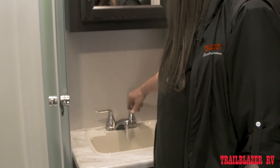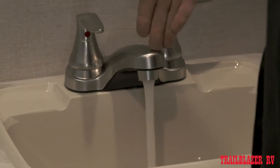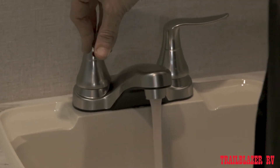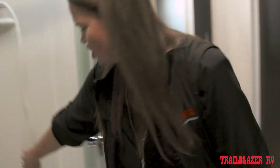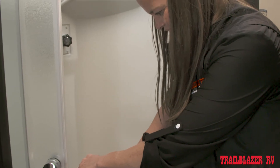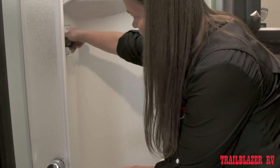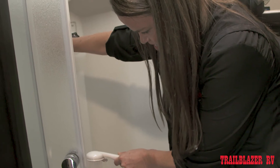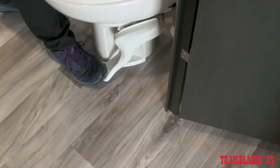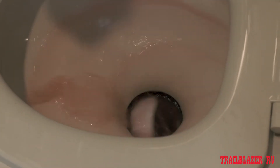Cold first. Got to give the pump a second here to re-pressurize after it ran dry. We've got clear running there, and then the hot tap. So that runs pink. We've got the shower — so that runs pink. Hot side. And then finally the toilet. This is obviously only cold water, but run it till it runs pink.